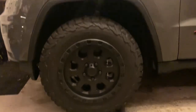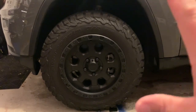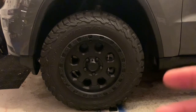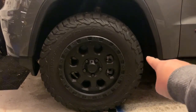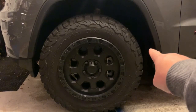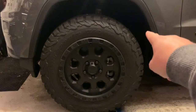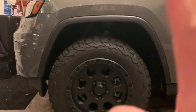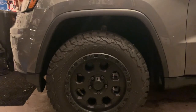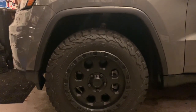When you go into off-road one or off-road two there's still plenty of travel. You could probably fit a 275/65 in here. I will say with this setup — the nine-inch-wide wheel and the plus 35 offset — I do rub right here. The felt cardboard-like piece does have some scuff marks; when I come in and out of my driveway, I rub just a little bit. But overall with the Air Link, for $50, I do not think you can find a better upgrade to a vehicle than that.